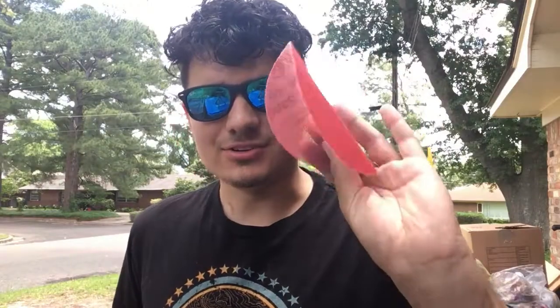My jeep's been painted before but I didn't do such a good job last time — I'm a lot more confident this time. Now I have this 400 grit sandpaper. I'm going to sand over the primer and then paint it a little lightly before I start painting it.